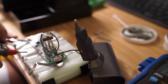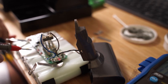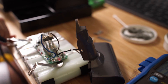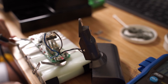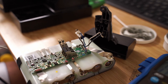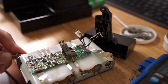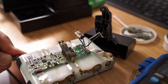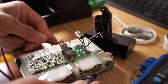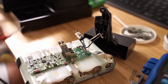To check voltages, you want to measure each strip and make sure that the voltage for each battery measures 3.6 to 4.2 volts depending on how much the batteries have been charged. Then make sure the voltages are in multiples of 3.6 to 4.2 volts to confirm they are correctly soldered to form a series connection. For example, B1 will measure 3.6V, B2 will measure 7.2V, B3 10.8V, all the way up to B6 which should measure 21.6 volts. You can see which metal strips are B1 through B6 by looking at the battery management circuit board — they are each marked individually.